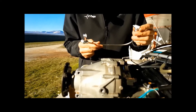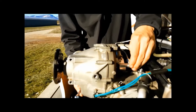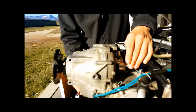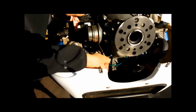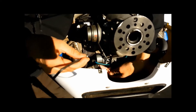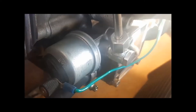The oil flow hose is a rigid stainless steel hose. Slide it in like this — it goes from the oil pump straight to the solenoid valve. Keep it loose to be able to fix the hose on the other side. Here you have the oil socket, which can also be used for the turbo. Remove the cap — there can be some oil leakage. Screw the hose with the joint and tighten it with a 14mm wrench. Tighten the other side as well.